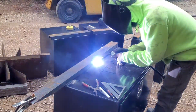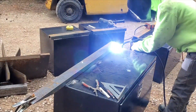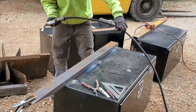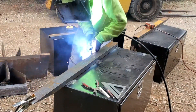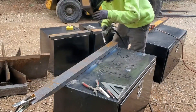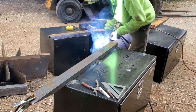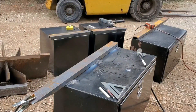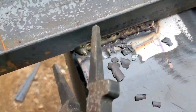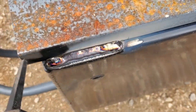So here's another shot of that big box. You see that tapered piece of C-channel that we cut with the plasma cutter earlier — that goes in front of the rear axle. That tapered piece of C-channel is close to the rear dual wheels, so it's tapered a little bit to make sure there are no sharp edges, nothing sticking out, even if the truck suspension starts to squat a little bit. And what that does is that piece sticking out there allows us to catch one more cross member on the underside of the flatbed.